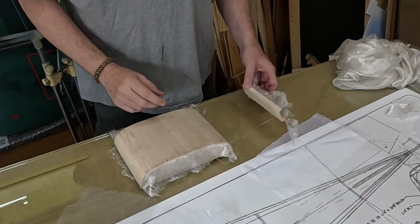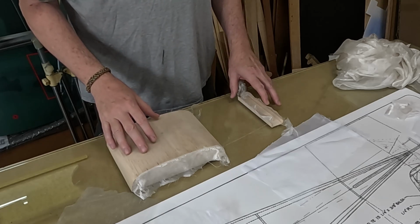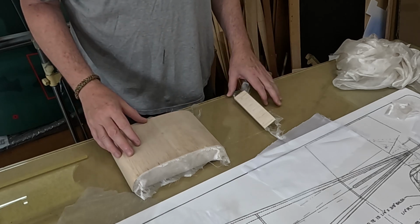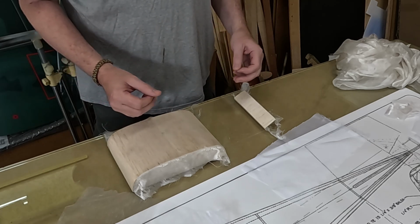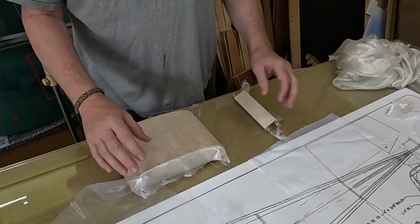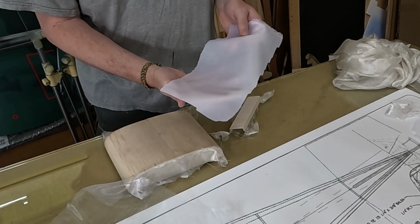These two parts, the landing gear cover and the battery access door, have been fiberglassed and the peel ply has been removed. What I want to show is the different texture you can get depending on the kind of peel ply that you use. Now I'll say right now, I've never used the trademark peel ply, so I don't really know the kind of texture that it gives. But I do have two pieces of 100% polyester, and they're a little bit different. So the gear door cover peel ply used was, I believe, called China silk.